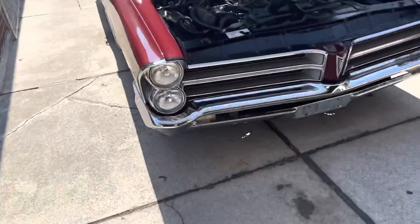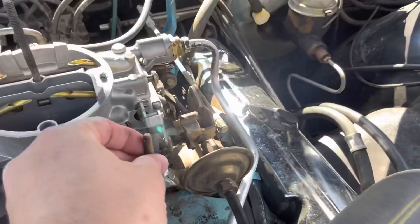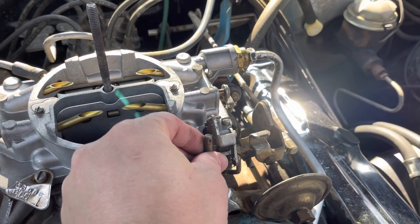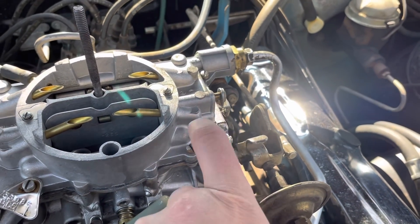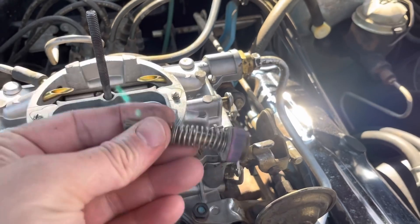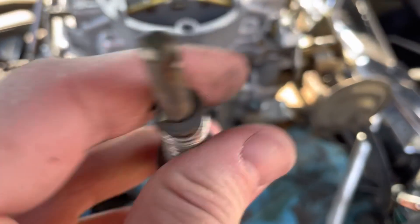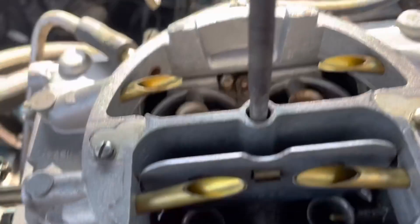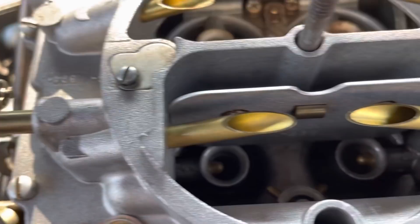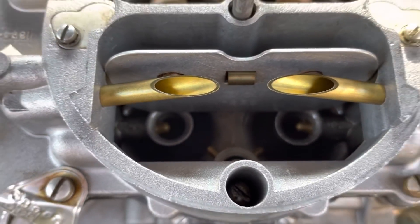When I was driving this car before, it would just bog if I stepped on the gas and it would stall — very typical accelerator pump issue. Here's the accelerator pump; this is what sits right here, and you replace it by taking this screw out. Then you have to take the top of the carburetor off and take this little S-clip out. This is the old one — you can see it's dry and not sealing well. When they don't seal well, when you step on the gas, you don't get fuel through the pump discharge nozzles. Now watch when I step on the gas pedal — see it squirt? Getting good discharge now.